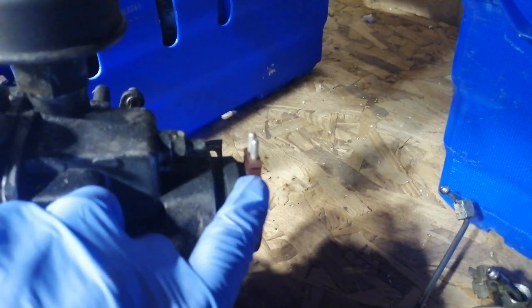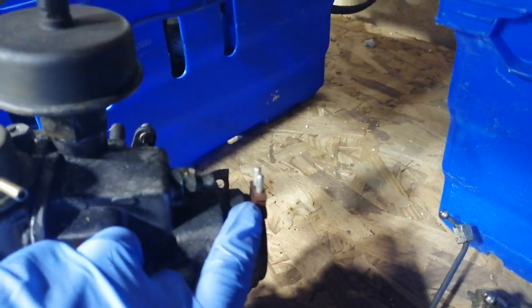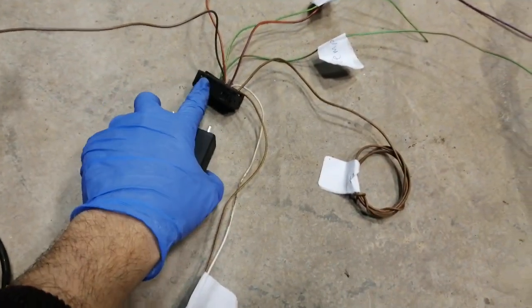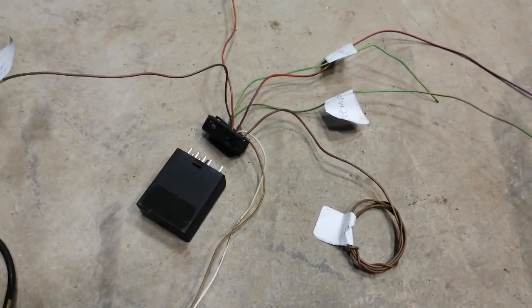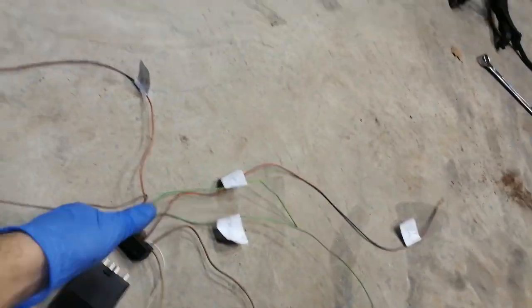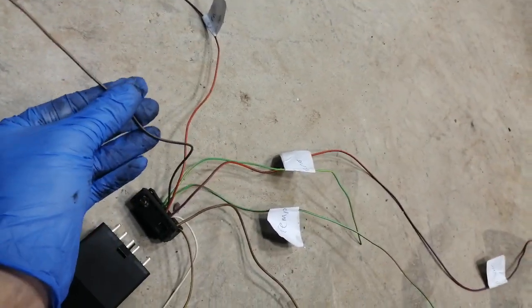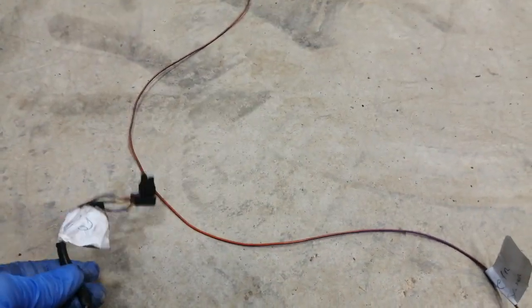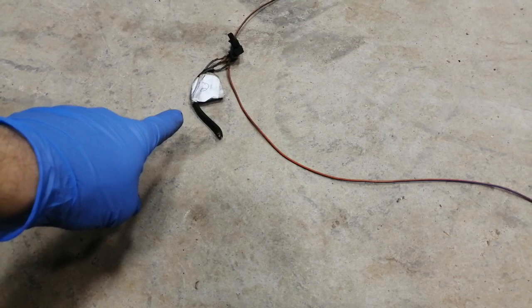You'll have seen this on the back of the pump. Let me pull this out so you can have a better look. On the back of the pump you have these two systems here. That's your ELR — and at that connection the connector is called a Y22 connector. Essentially it's an electronic vacuum system that raises and lowers the idle to suit. So that's your ELR module and that's the matching plug. It has a feed here — two wires: a brown and blue and a red and blue — going to the ELR plug, the Y22 plug at the back of the diesel pump.